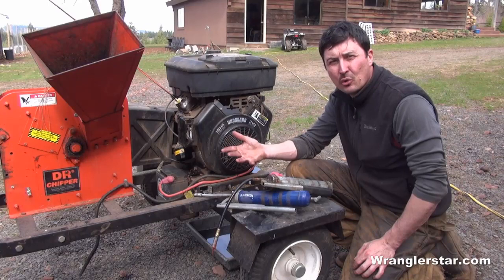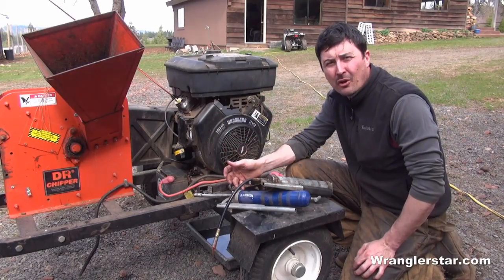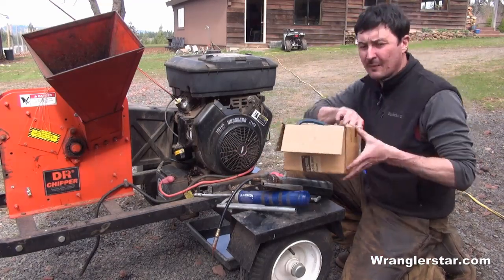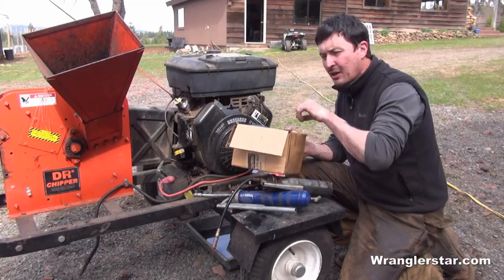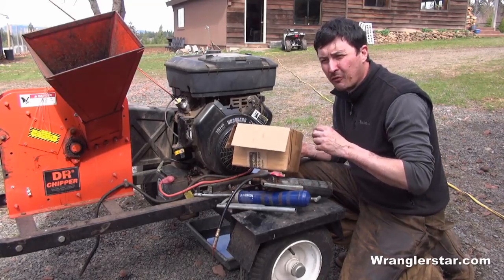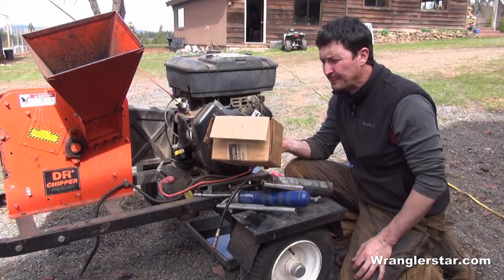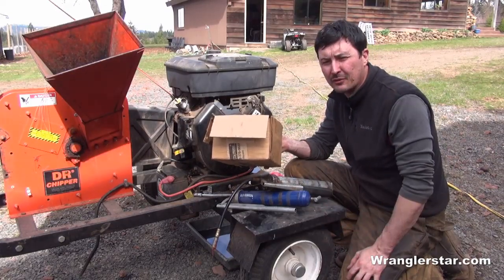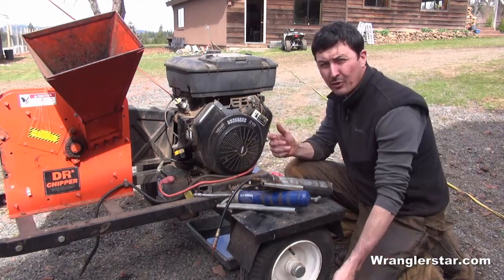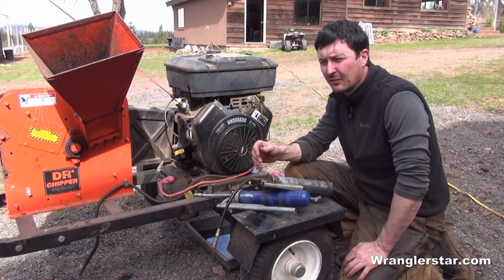You decide you want to use your tool and you don't want to take half a day going to the hardware store chasing all this stuff down. So make yourself a little box — write the power tool on the front and keep the paperwork in there. Write down what spark plug, write down what air filter. Take this info and go on eBay and order that stuff, get it delivered to your house. Then put it in the box, and next year when you're ready, it's no big deal. It just saves you aggravation and a lot of time.